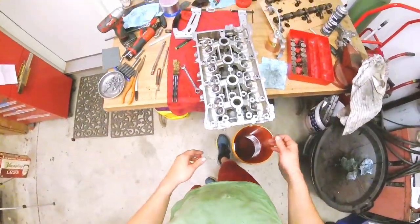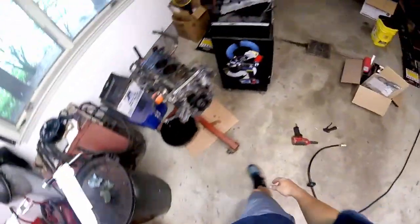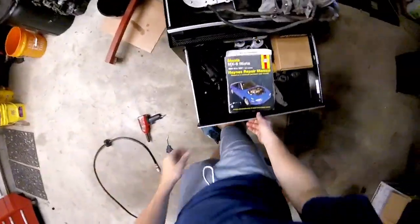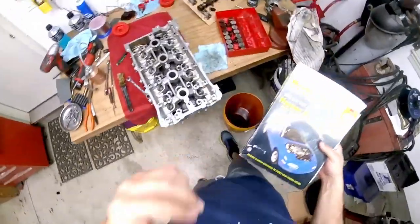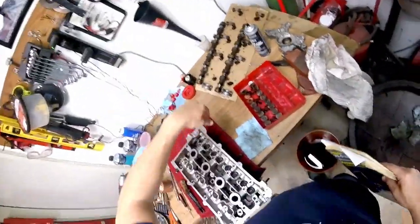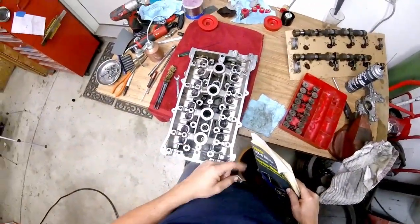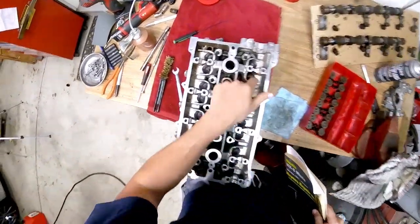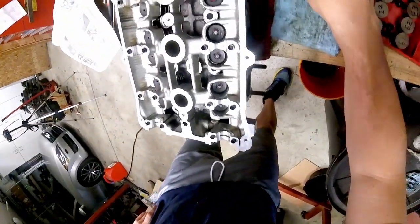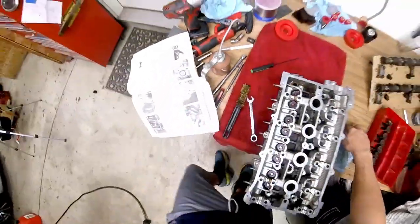So you can see our head is way more clean than it was. Now that the valves and keepers are all installed, I'm going to tap them with a hammer and a rounded-off socket end, just to give them a chance to vibrate into place one last time before revving as the motor turns on. Yesterday we finished up all the valves, so I don't need my valve tool. I'll use the book because I don't know all the torque specs off the top of my head. We're going to put the lifters back in in the order they came out — which is why we labeled them — then we'll put the cams in and then the caps. Caps only go in one way and in one order facing one direction, or you'll crack them as they have to mate with the bearing surfaces.